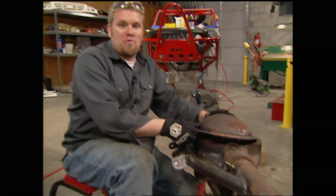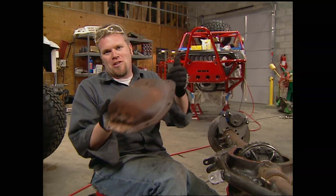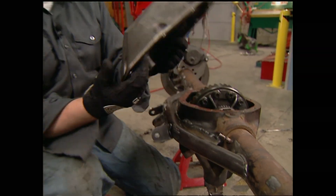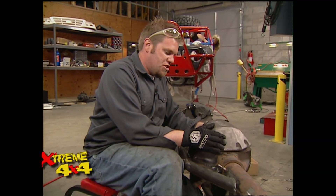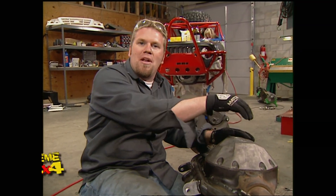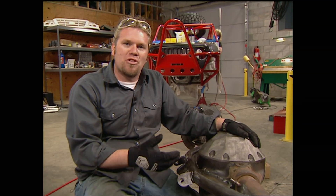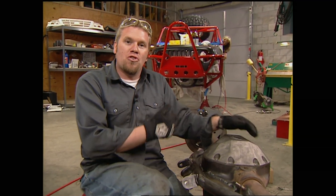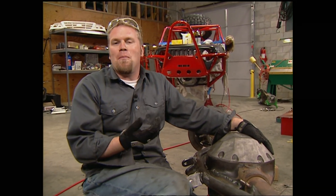The last piece on this rear axle is a new indestructible diff cover from Crane High Clearance. It's a chrome moly alloy cover with a lipless design — you just set it on the axle housing, line it up, and check that the cover isn't overhanging the bottom side of the diff. If it does, just grind a bit away so it won't get hung up on obstacles or rocks. Crane also raises the diff fill plug up on the cover, so if you tilt your axle to compensate for pinion angles, you'll still have enough fluid in there for your gear set.